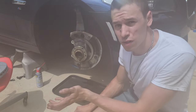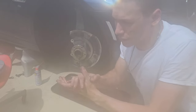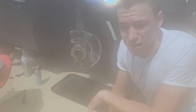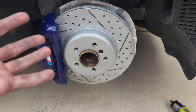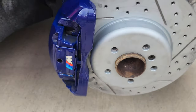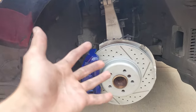Here's what's happened so far — I haven't recorded a lot because my phone has been overheating. On the passenger side it's the same process: removed the caliper with two 18 millimeter bolts, removed the caliper guide retainer, cleaned up the hub, and now installing the new disc. I'll just time-lapse it. It is so humid that midway through speaking my lens fogged up — I apologize. This side is a lot less scratched since we knew what to do. Done — no casualties other than a broken nail. Dirty hands, dirty job.